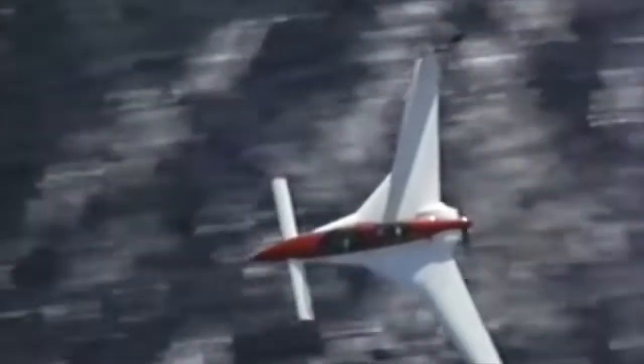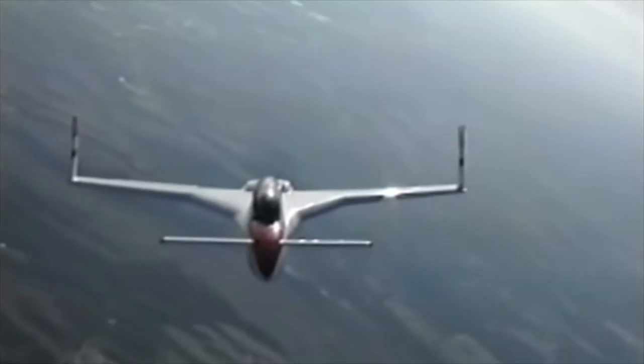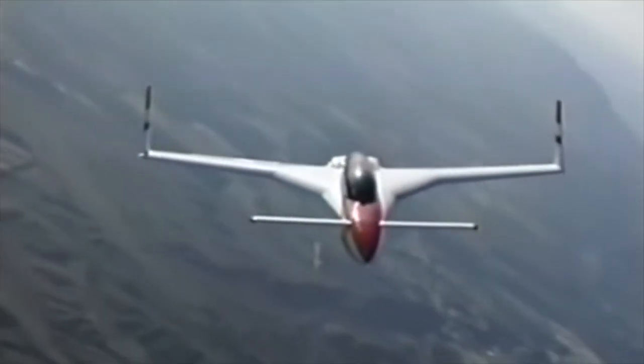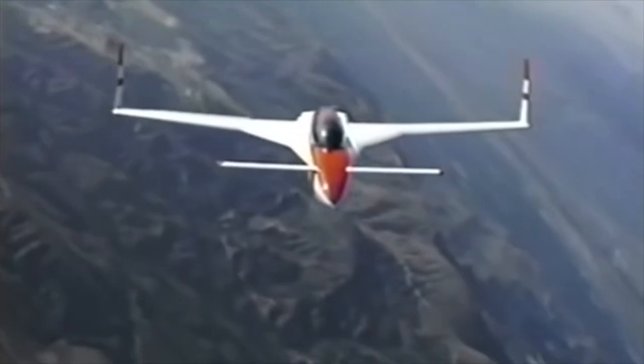Lightspeed Engineering. The electronic unit provides multiple spark discharges through the top set of plugs, plus a spark advance, which improves fuel consumption, provides more power, and because combustion is completed in the cylinder and not in the exhaust pipe, the result is reduced noise levels not only on the ground, but inside the aircraft as well.